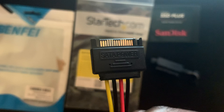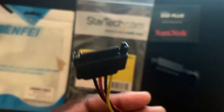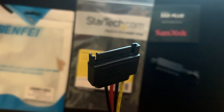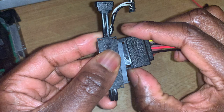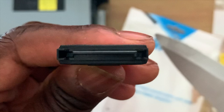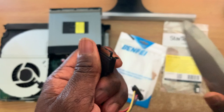This wider cable is a SATA power extension cable — also used in PCs, also cheap. I bought a pack of three on Amazon for £5.95, that's about $7.51 US. Out of the packaging, this cable won't fit where we need it on the Xbox drive connector because of a little plastic tab on the side, so we need to remove that. It's the tab on the same side as the right-angled kink. If yours doesn't have a tab, you don't need to worry about this. But if it does, removing it is easy — just slot it in here and pull the tab off.